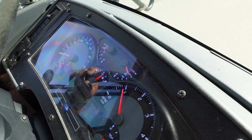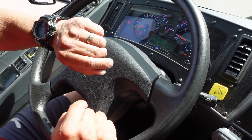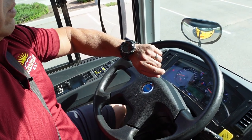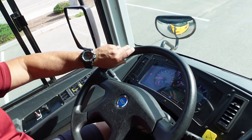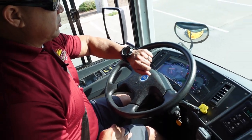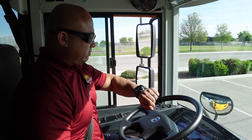Next I'm going to do my static test. I'm going to turn off my engine and turn on the key since it's a digital system. On this test, I'm not allowed to lose more than two PSI per minute. Any movement of my needles will indicate air loss. If there was air loss, it would be coming from the treadle valve or the service brake valve, line to the tank, and any loose fittings in those components. I'm going to time myself for one minute because that's what CHP requires. A minute has passed. Next I'm going to do my apply test by applying my service brake and releasing my parking brake. On this test, I'm not allowed to lose more than three PSI per minute. Any movement of my needles will indicate air loss — it would be coming from my service brake valve, parking brake valve, lines to my tanks, lines to my brake pods, and lines to my spring brake chambers, and any loose fittings in those areas.